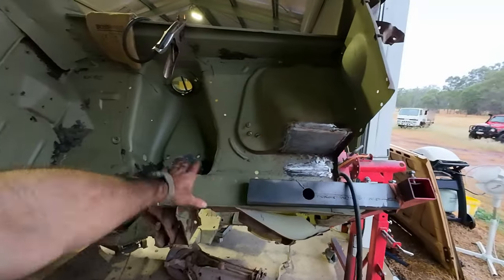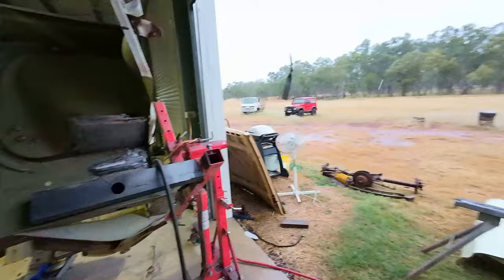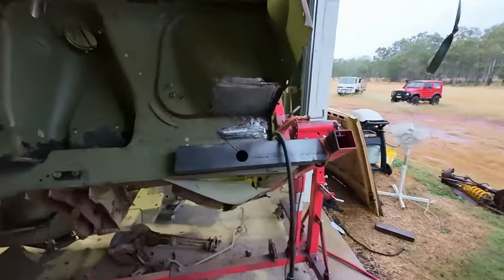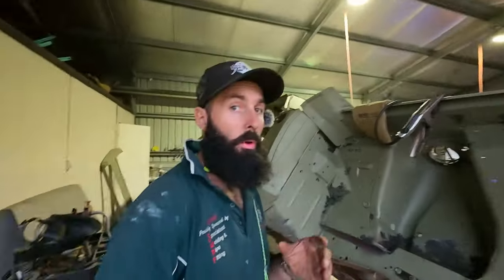One last tip: once you've finished doing your repairs, don't leave it as exposed steel - obviously rain and moisture will start rust right back to square one. And that's why I don't ever do lap joins, because it's just introducing more area for rust to start from moisture trapped in the lap join. I don't do lap joins - I'll butt join everything.